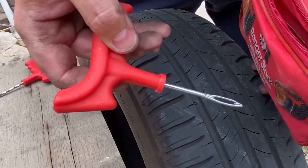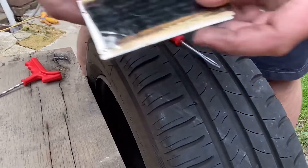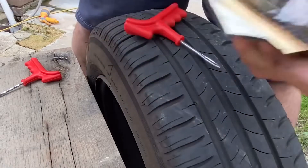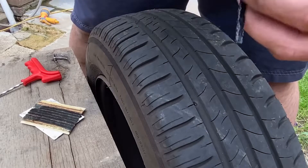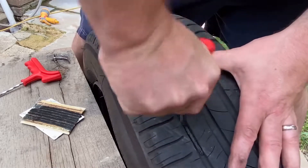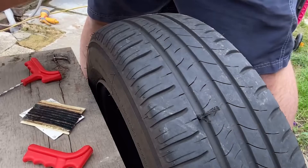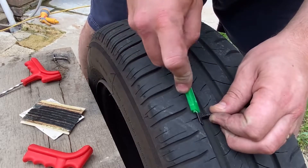Now we're going to get our little needle tool. You see there's all sorts of things in the kit — we're going to use these black rubber things that look like liquorice. These are our plugs essentially. So we pull one of those off, stick it on the needle tool, and push it in — past where you think it needs to go. Then we pull the needle tool out. What you didn't see on the end of that needle tool is a very small cut, so when you pull it out it actually cuts that black liquorice thing in half and pulls itself out. Now we can cut those little tails off.